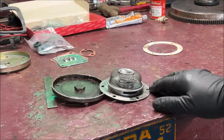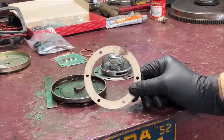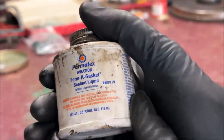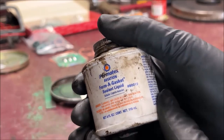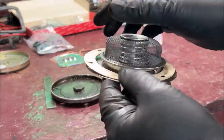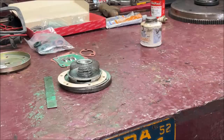Don't forget your strainer. Engine kits come with oil strainer gaskets, but you can buy them separately. You want to put a little bit of Permatex Aviation Sealer — it's almost liquidy — on each side of the gasket, on the side that goes up to the block and the other side. Then your strainer plate goes on top. So you want sealer on all of that.